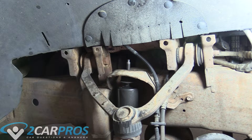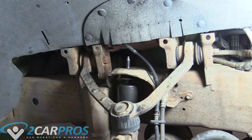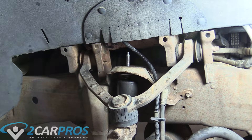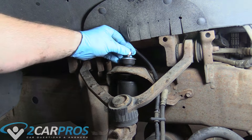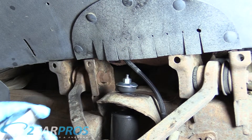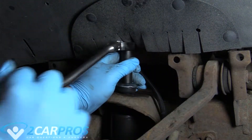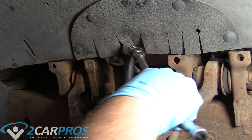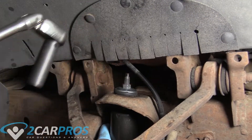Now I've gotten the car lower to the ground. I have a jack underneath the brake rotor and I'm just going to jack it up here to expose more of that thread. This is actuating the suspension so I can get the next set of bushing and washer on there, and we can install that. We can tighten that up with our 15mm — we want that on nice and tight. Once you get to this stage the shock might start turning on you, so you need to hold it. And there we go.